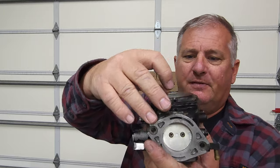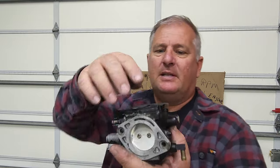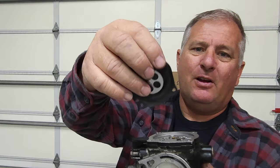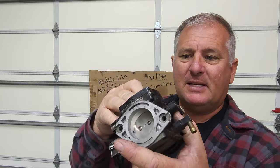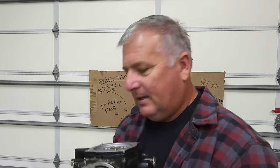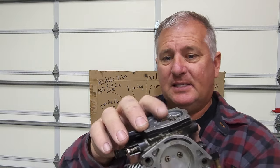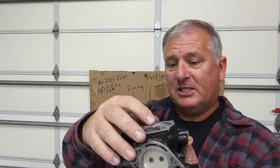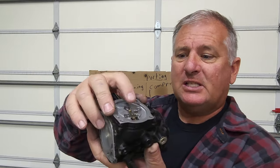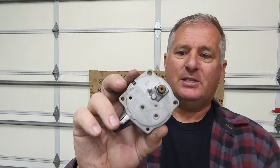Here's the fuel plate. The fuel plate cover comes off and exposes the diaphragm. The diaphragm — I call it breathing — pulses back and forth between the fuel pump, creating pressure on the backside of this little spring armature. That is your needle and seat. This dictates all your fuel flow for the whole spectrum of the carb, and it is adjustable. The spring is adjustable, the tension at which it pops off is adjustable, and the hole size is adjustable.